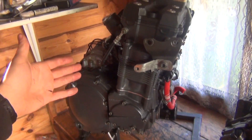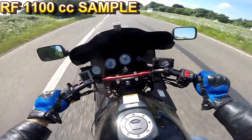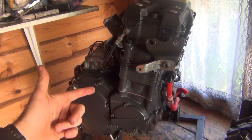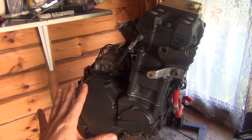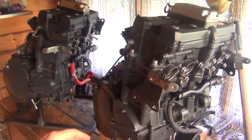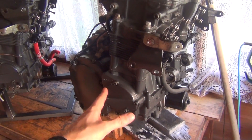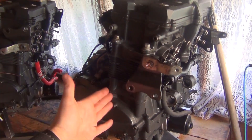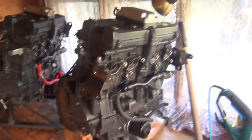I had it in my bike running really well, and that was a fantastic success. There was a lot of mess and things had to be done to make it happen, but it all worked out pretty well. About a year later, I decided to build another engine. This is basically a stock RF900 engine in which I've installed an RF600 slash GSXR 750 gearbox — so this has a six-speed transmission, and apart from the gearbox the rest of it is all stock. And that worked out pretty well as well.